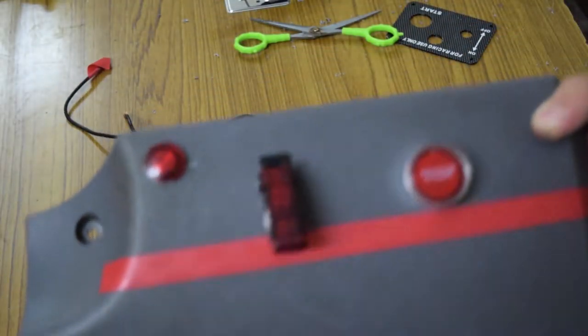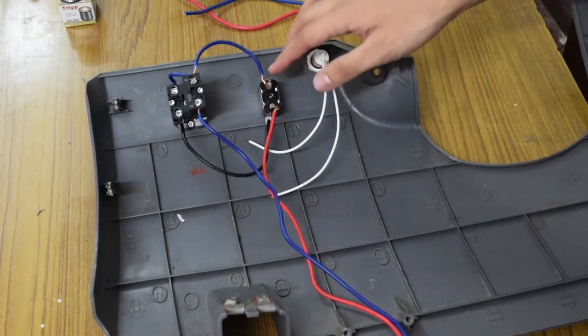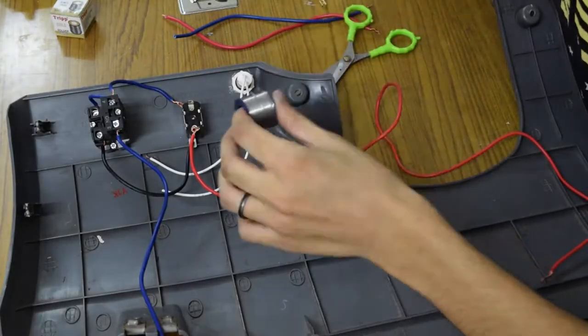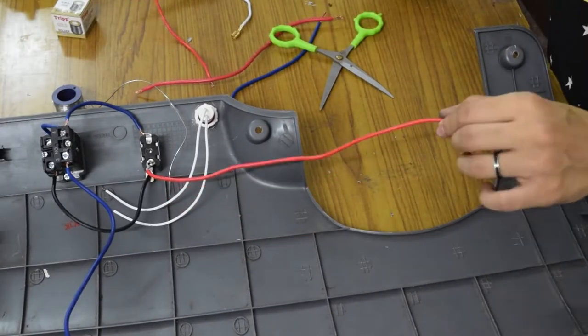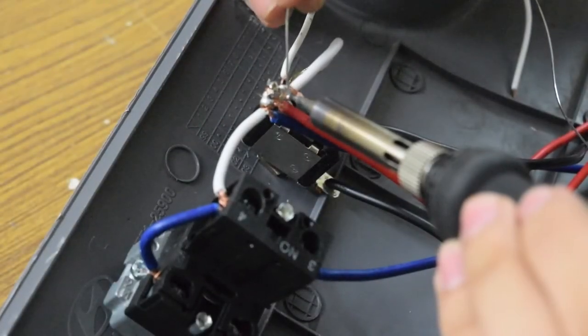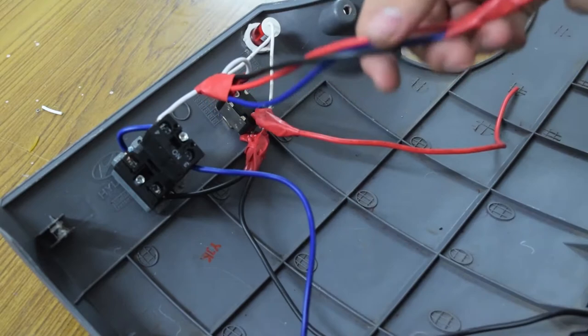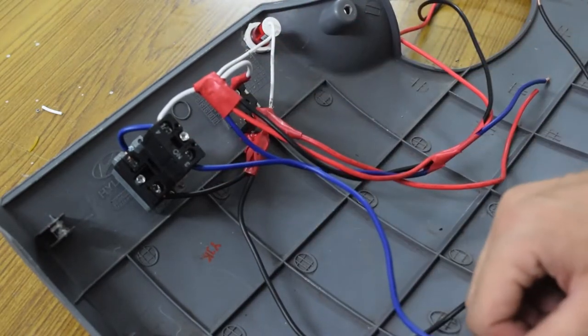The mounting is complete. I've tidied up the wiring and finished soldering the joints. I also need to tap three wires from the on position of the toggle switch to power all the accessories. I've completed all the soldering and insulated all the wires — these three are the accessory wires, this one is the light, this one is the ground, and this one is the ignition. Now we'll go inside the car and connect all of these.